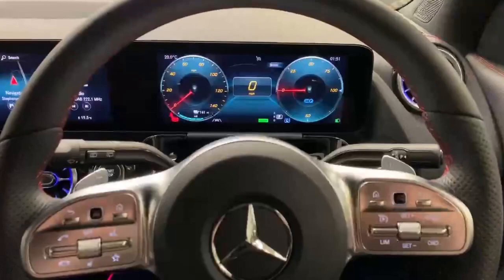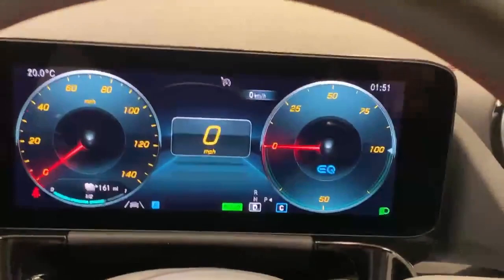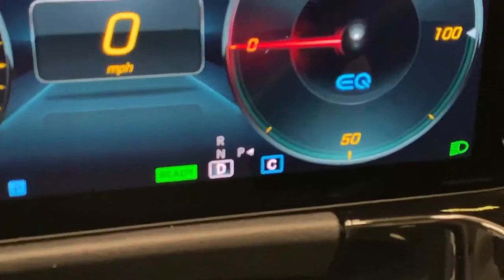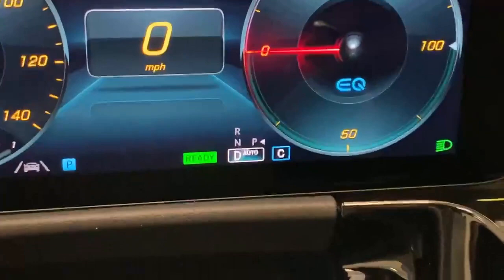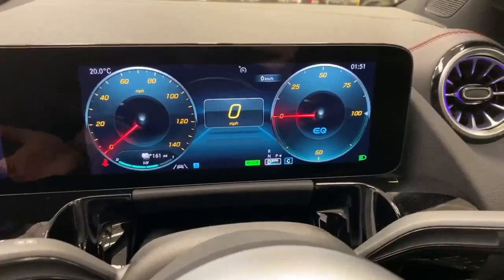Next, the driving styles of the car. When the car is in drive and ready, there are different levels of recuperation for regaining energy into the batteries. Since there are no gears, the D symbol shows the recuperation level instead. If you pull and hold the paddles — either one — it goes into D-Auto, which is the automatic mode for regeneration. This means the car will brake using the motor to regain energy rather than using the actual brake pads and discs. In automatic mode it figures out the best approach — whether to coast or recuperate energy at any given time.